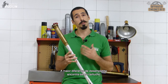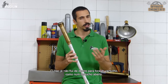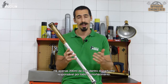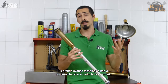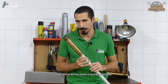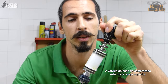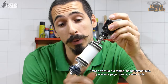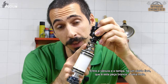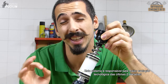The biggest difference in terms of performance is in the cartridge. The oil doesn't flow in and out of the cartridge anymore like in an open cartridge fork — you just have around 200ml of oil responsible for the whole damping. The great breakthrough isn't turning the cartridge upside down, but how they closed it. The compression base valve is attached to the top cap. Between the top cap and the base valve, you have a free piston — this white piece — and a spring. This system is responsible for the biggest breakthrough in suspension technology of the last two decades.